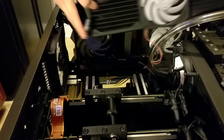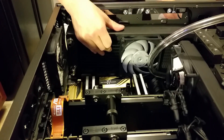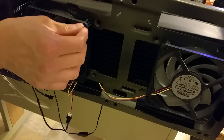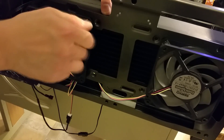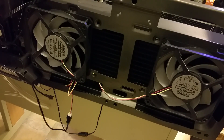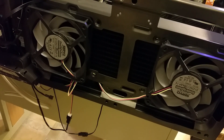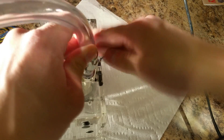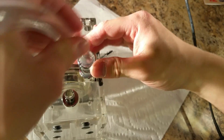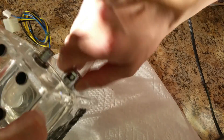Now it's time to mount radiators. Align your radiators with your case fan mounts and you can either screw through the fans through the case to attach the radiator, or you can directly attach your radiator to the case if you want a push fan configuration. My top mounted radiator has two fans pulling and one fan pushing because this was the only mounting solution I had that guaranteed motherboard and compression fitting clearance. Depending on your case configuration, you may have moments where you need to get creative like this. Before placing our reservoir and pump into the case, we need to attach the tubing because this area will be very difficult to access once it's been installed into your case. Place the tubing overtop the compression fitting opening and tighten the nut down over the compression fitting.